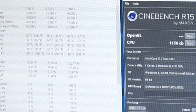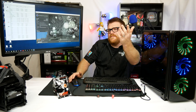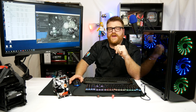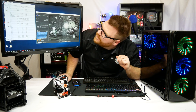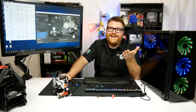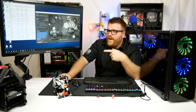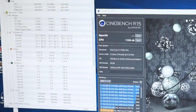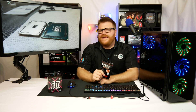There we go — 5.4 GHz, that's as far as it'll go as far as I can tell. The Cinebench score is 1156 — only about 25 points higher than what I get at 5.2 GHz. Running the benchmark: 92 degrees on the package, which all things considered at 1.5 volts is not a bad temperature for a Cinebench run. I'm going to get this turned off because it's way too loud.